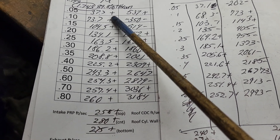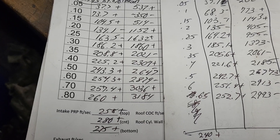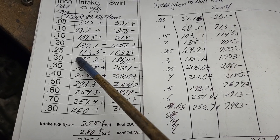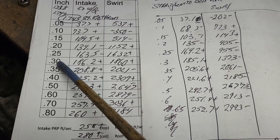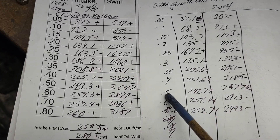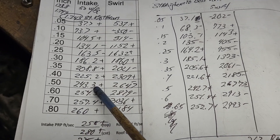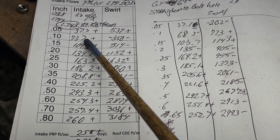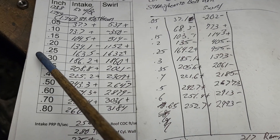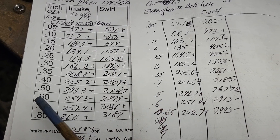How'd we do? Plus, plus, plus, minus, minus — I'm going to take it as a win, guys. I had a feeling the 50 would be a win. 186 at 300 — not great, but not bad. At 500, 243 and change. Not really a big difference there, but it actually tops out a lot better. The rest of the gains are not huge. The 50 is supposed to knock back the low lift flow, but it never seems to happen for me that way. It seems I always gain on low lift flow with a 50.